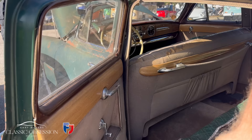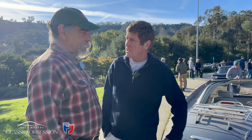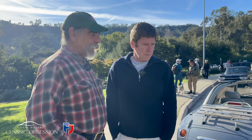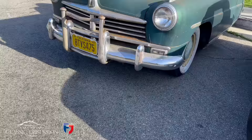What's the story — was it just sitting in a garage? To the best of my knowledge, this car originally came from Indiana. People moved to California to Rialto around 1960, drove the car out here, put it in a garage and left it. The fuel tank was rotten so it's got a new one. Luckily I didn't try to start it because these cars still have a splash lubrication motor — the oil pump pumps oil into a tray and the rods come around, hit the tray and splash the oil around. Well, the sludge was in the tray and the rods were blocked — it was terrible. So I had to pull the pan, and on this car in order to pull the pan you have to drop the whole front end out, which isn't that bad. So we pulled the pan, rebuilt the carburetor, rebuilt the generator, did the starter, did the brakes — went through the whole car.